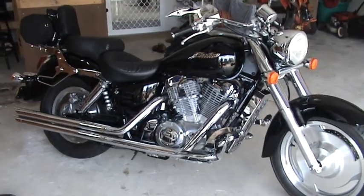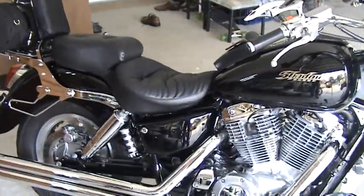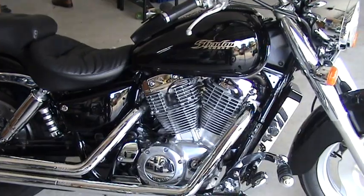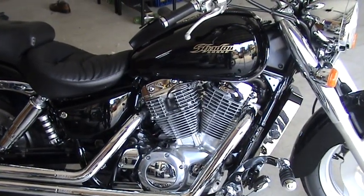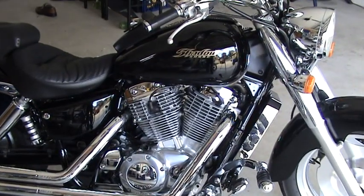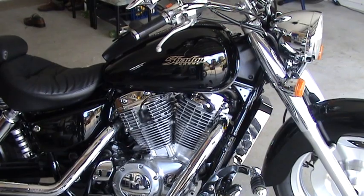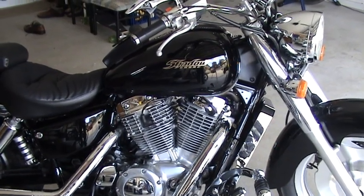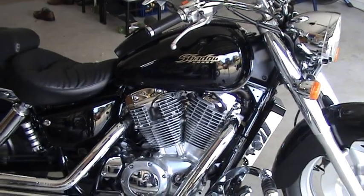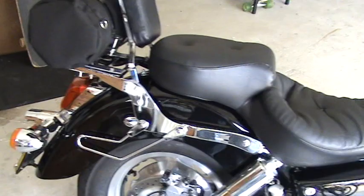Okay, this is a short video of what we call on the Sabre Group forum the Full Monty carb rejet. I haven't started the bike yet. I've got number 48 main pilot jets in and dual 175 mains. Pilot, the AF screws are out 1.5 turns.